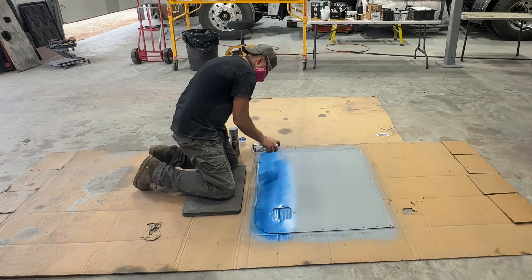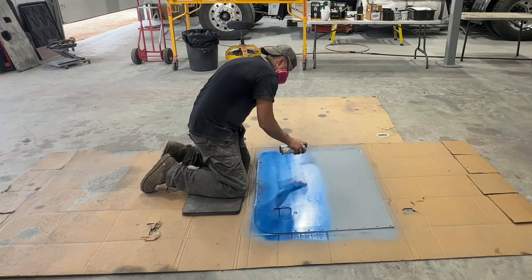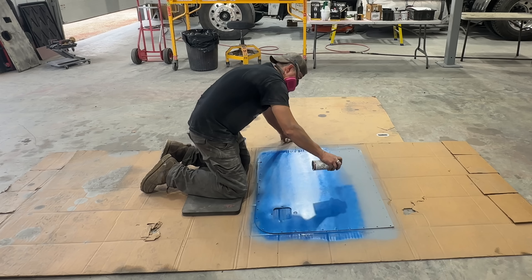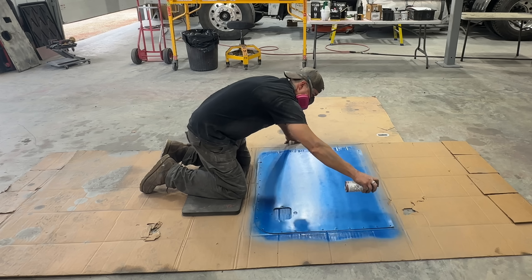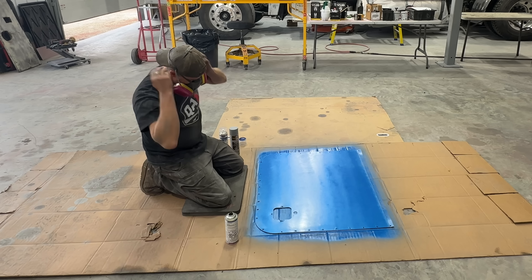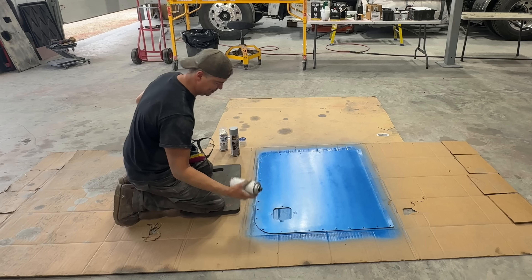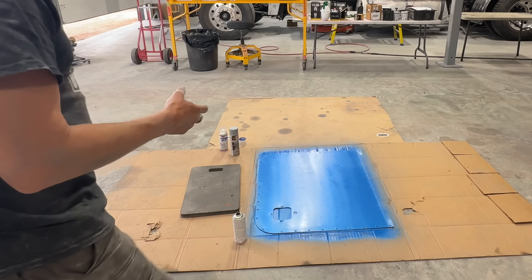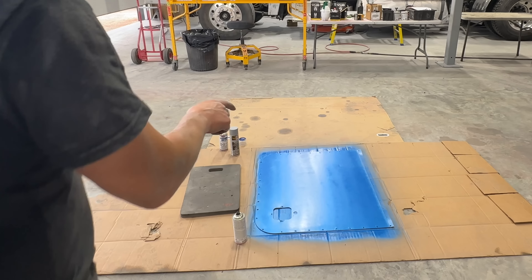Let's lay down this blue. Now your first coat is kind of the coat where it's almost like putting on glue — you don't want to lay it on too thick. With a spray can you can't really change your flow. It's just the coat that's allowing you to really lay it on thick in the second and subsequent coats. This is very similar to what I did last episode with just a single stage blue, but it kind of turned out matted and I didn't really like it. So I'll wait till this flashes off — Mark told me 15 minutes. Respect the time, respect the process. I'll put a second coat on, maybe even a third coat, and then I'll wait two hours and put on the clear, and then this should really pop.